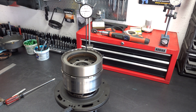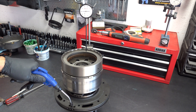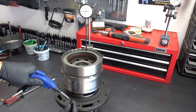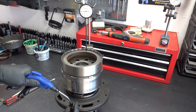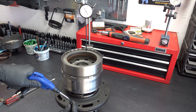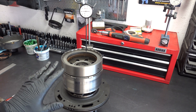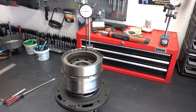Pump fully assembled here — here is your forward feed and here is your direct feed. I'm going to put air in the forward feed and we're going to watch the indicator and see what we have. I measured this off camera initially just to see where I was truly at and I was getting like 18 thou, but it looks like I may have a little bit better stability here in the indicator on camera versus off, which is rare. It's usually when something could go wrong, it's going to happen when the camera is rolling.